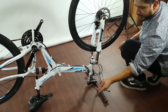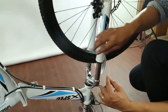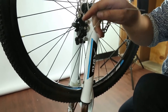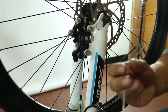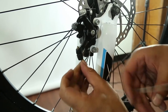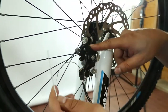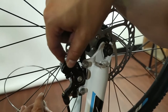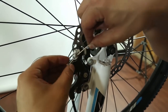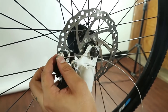There is a loose brake wire that you're going to feed first through here. Make sure that the plastic tube goes all the way through. Now here is a little tube in there — you're going to feed it through here. And now you're going to put the wire through this little loop right here. You might need to loosen this, so you feed it through, and then tighten it.